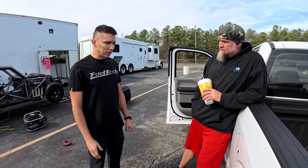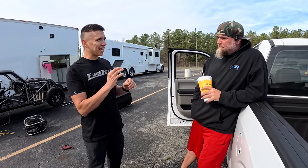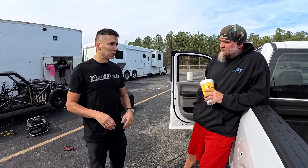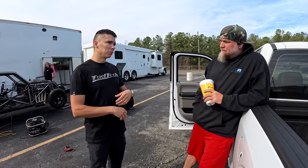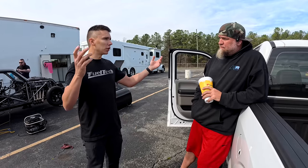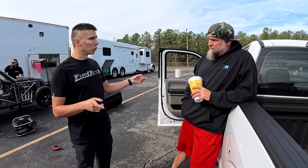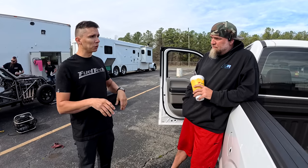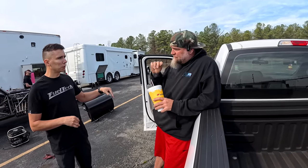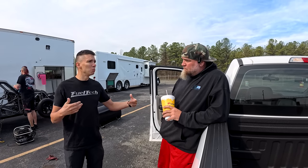The active one, it's the other way. It's always trying to understand what's going on, but it's not as precise as trying to go 350s on the track, right? So on the track, it's not that useful, but if you have an unknown track, like a bare concrete back of the track or a no prep style deal where they are not prepping it properly, it's actually better. And it works really well on four-wheel drive as well. Because you will have the reference between the tires, and you can set where it doesn't activate at really low speed. So if she tries to pull the front end up, it won't affect, right? But it's four-wheel drive, it'll move, right?